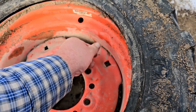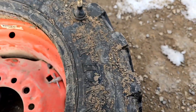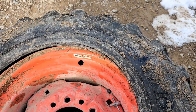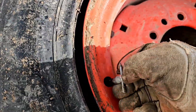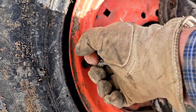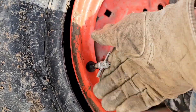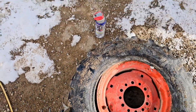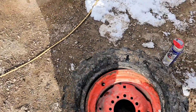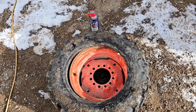I like to use a little bit of some kind of lubricant — whether it's soapy water, I'll spray a little bit of WD-40 on there, it's a nice little lubricant. Put it through there, use a little tool, thread it on the end, put pressure on there and give her a pull — and we have a valve stem. Really simple. It's a lot simpler if you don't get a flat tire and ruin your bead and pop the valve stem out. Screw your head on right in the morning and pay attention, like I was not. I should have known that tire was low.